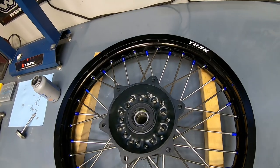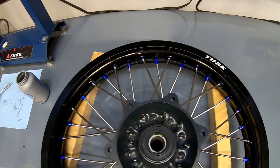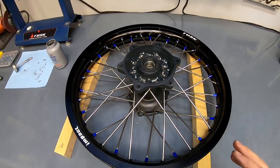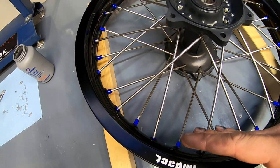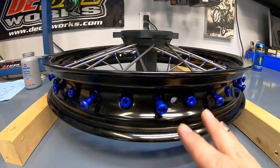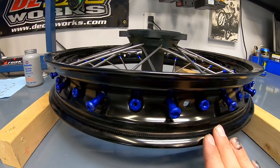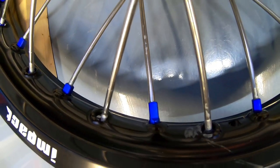Your 36 spokes are loosely installed and your wheel is technically laced. The next step is to tighten all the spokes evenly, but not too much to start. My general rule of thumb is to tighten each nipple to where the threads are no longer showing — that is my starting point. Depending on the style of nipple, you can definitely do this with a drill or an impact. This is much easier if they're Allen or Phillips style — flat heads are kind of a pain. I'm just going to go around for every spoke until I'm just at the top of the threads.